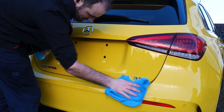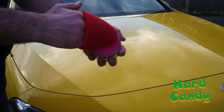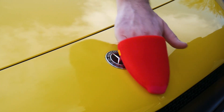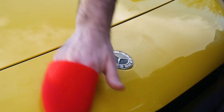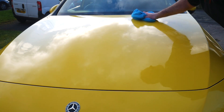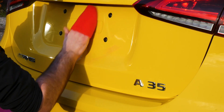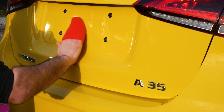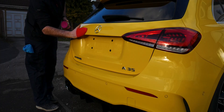Once you've gone around the entire car, move on to waxing. With the red finger applicator pads, warm up a little bit of the product by rubbing in circular motions in the pot until some product comes onto the applicator. Start with the roof, then onto the bonnet, and work around the car one panel at a time. Work the wax in circular motions, allow it to haze off, then do a swipe test with your finger to make sure it comes off clean. Then go around with your Fantastic Firm microfiber and buff it off to a high shine.